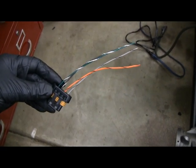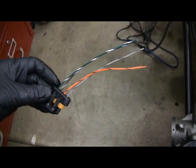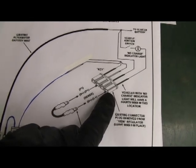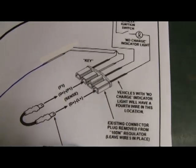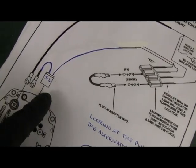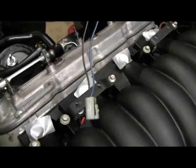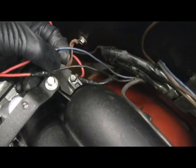I bought this pigtail from Wiring Specialties online — it was eight bucks. I went to the junkyard to try to get one but could only find single wire and a two-wire, not the second wire from the post that I need for that drawing. The jumper needs to go from the end of the regulator connector to the third post over — see that little one-way tab so you know which side to do it from. Here's a jumper wire I made. That third connector over is what connects to the L on the alternator. On my regulator connector, the third terminal over is the black wire, next to the blue.